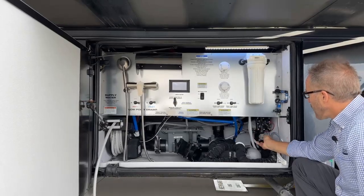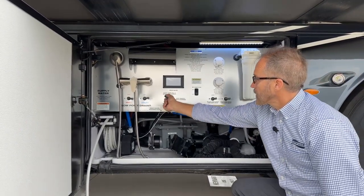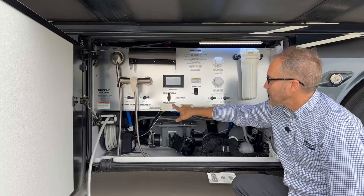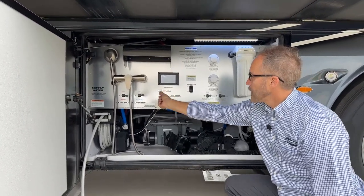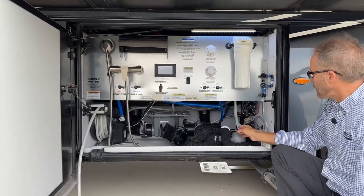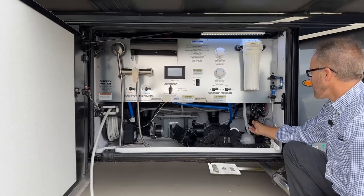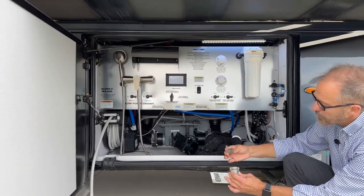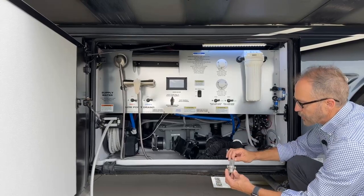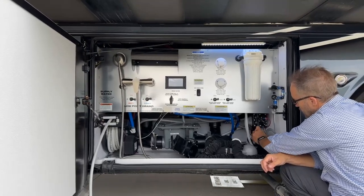To the right, I have my water pump. The water pump can be used when the selector is on either city or auto tank. If you turn the pump on when the selection is at manual tank, the water pump will continue to run. There's a filter that you can check manually on the front of the water pump — if you remove that, there is a screen that can be removed and cleaned. If there's any debris in the water, it gets filtered out there. Just put my screen back in and twist until it's tight.